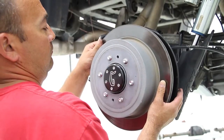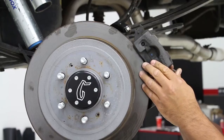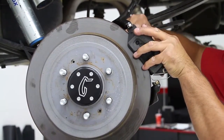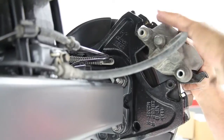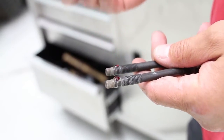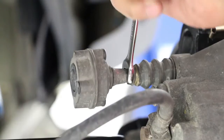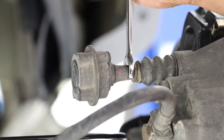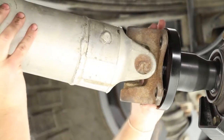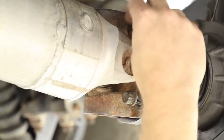Slide the factory rotors back into place. The center hole on the rotors must be opened up to 3.700 inch. Slide the brake calipers onto the rotors on both sides and use the factory bolts with Loctite to reattach them. If you completely removed the driveshaft, slide it back onto the transmission splines and then align the bolt holes with the rear end yoke flange. Use Loctite on the driveshaft bolts and tighten them.